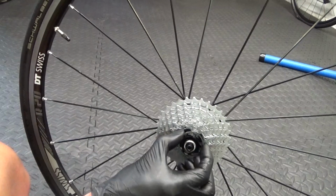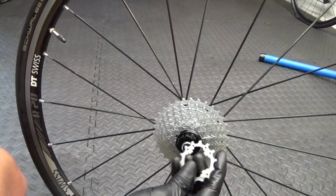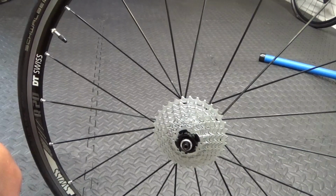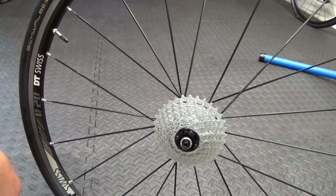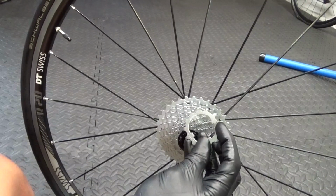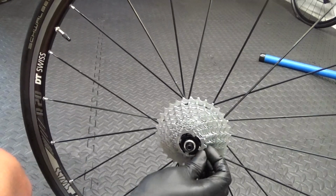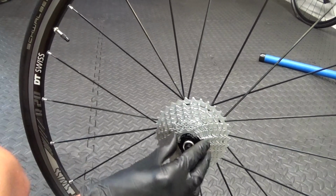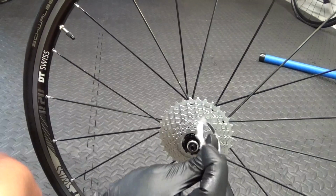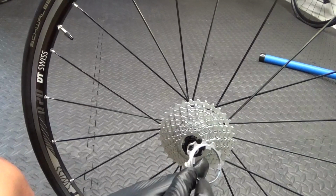And then another spacer like that. And then the next one, again the small notch in there. Then a spacer like that. And then next one, so we've got 3 left, so that one goes on. And then after this one you don't have a spacer now because you got the bump on the back of the last couple of sprockets there, so there's no spacer.